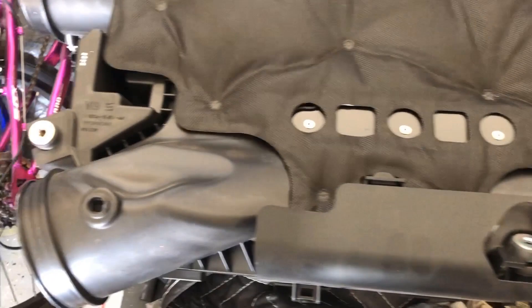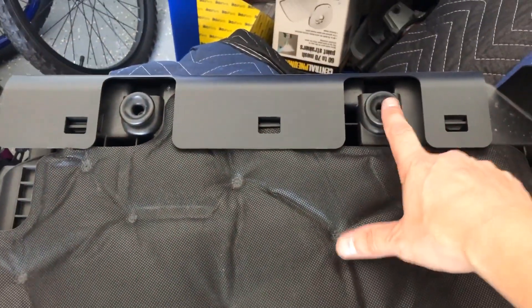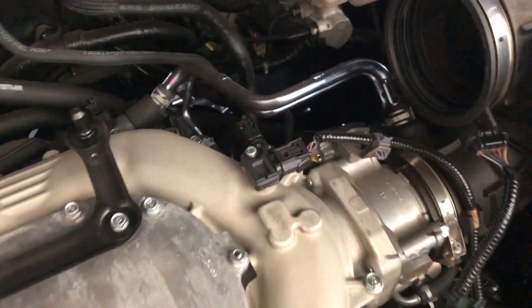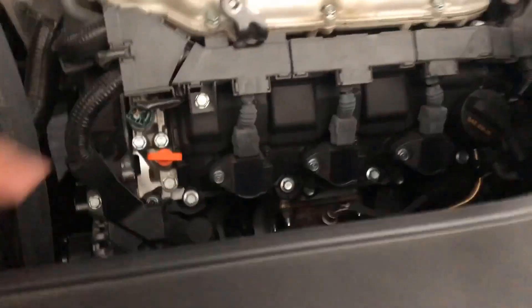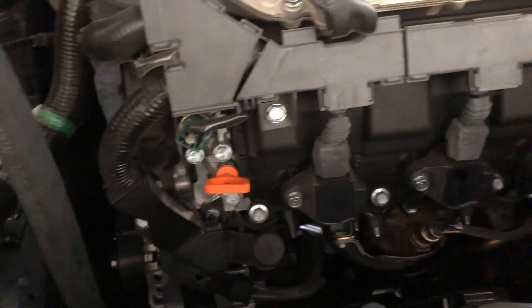The intake box is now taken off. The rear has just these little suction things — not very impressive when you take off that cover. But it definitely gives much more room. I also want to mention that if you want to do your spark plugs, your front three are here and your rear three are back here. With that intake off you can reach them back there. These are 10 millimeter bolts, so a spark plug change or coil pack change is fairly simple to do.